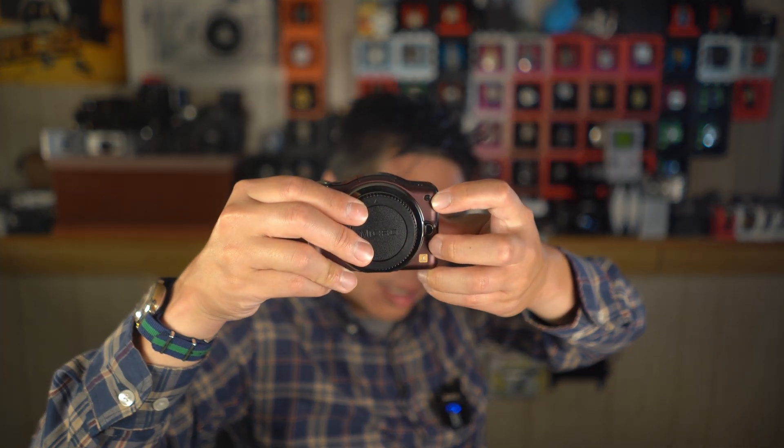I found it nice because depending on what I wanted to include in my build, I could literally take a pair of scissors and cut the part up. I ended up omitting the speaker built into the camera and one of the LEDs. I cut those out, reconnect the flat flex, and the camera doesn't care — it functions as you'd expect. One nice thing about not having these extra parts is I didn't have to worry about finding a space for them in my build.